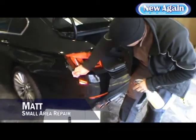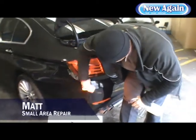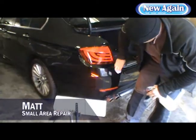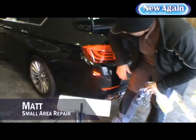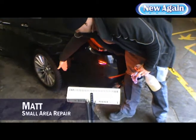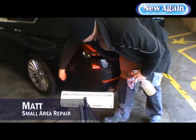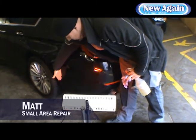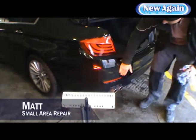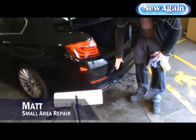So there's the damage on the corner there, which is only about the size of a big grapefruit. What bit do you intend to paint there, Matt? I'm going to paint it out to about here, fade it out to here. Because I'm going to follow this line. And because the light fades out here, I'm going to try and lose the lacquer to them — around this side, bring it down to this narrow spot, and lose the lacquer about here.